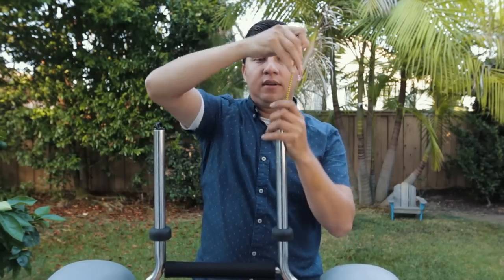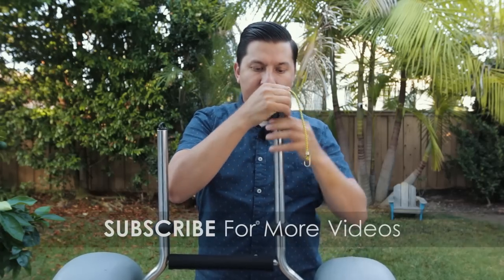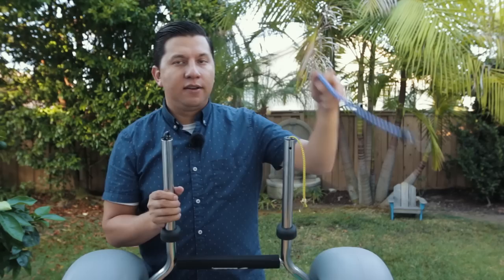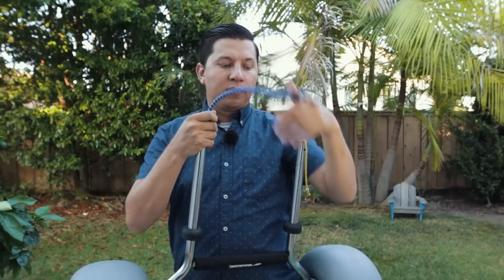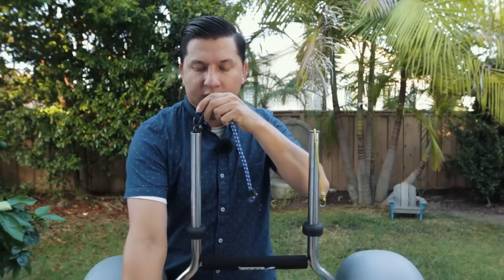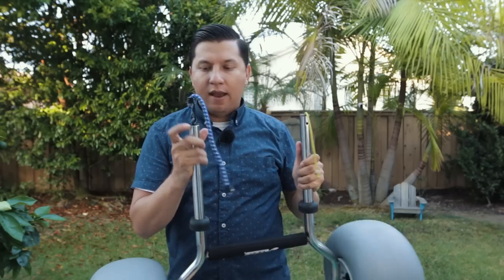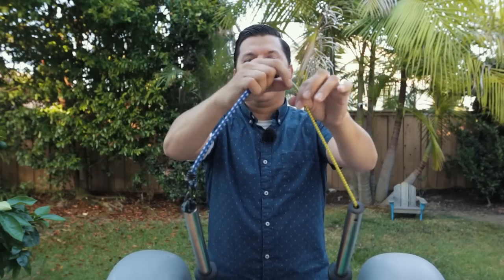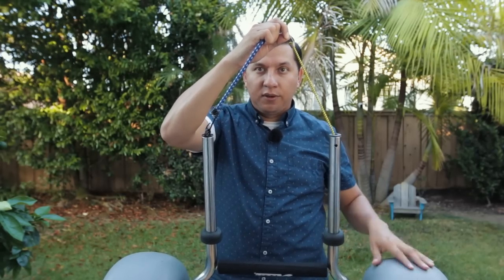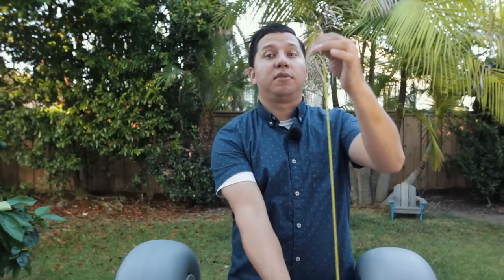On the top we're going to have a bungee giving us the force that we need — about a one-foot bungee. The other end is going through a loop on that paracord. On the other side, we're going to use a heavier bungee to do most of the work of pulling it up. The paracord is basically just for lining, and the heavier bungee is going to be doing most of the work. I'm going to crimp down one side so it doesn't come off, or just bend this part so it doesn't come off. I basically straightened out the hook and made it flat, so now when we put it under the cart, it's going to pull it up. It looks flimsy, but it's only doing the work of pulling up the cart, not the wheel — the wheels stay on the floor. So this should be enough tension, even with just one, to pop the cart in place.